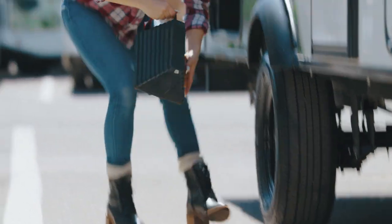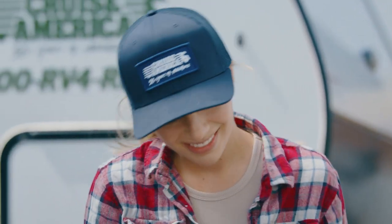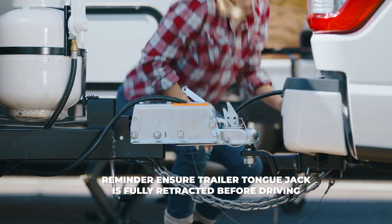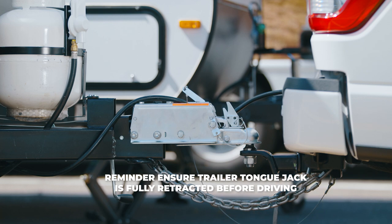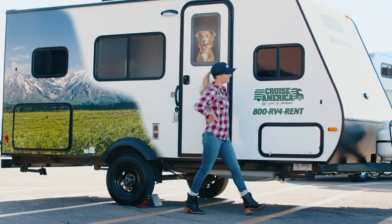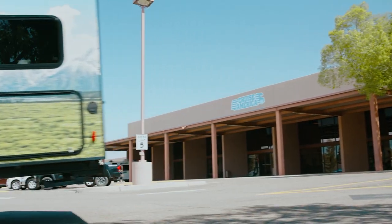Remove the tire chocks. Check to make sure nothing else is in the way and remove as needed. Final checklist: check if the cord, chain, or hydraulic brake lines are dragging and at risk of touching the ground. If so, loop them around as needed. Please allow enough slack for turning. Check to see there are no compartments or debris in the path of the vehicle. Lastly, ensure all your signal lights are operational.